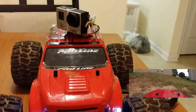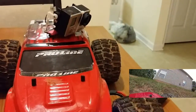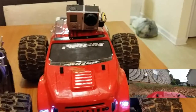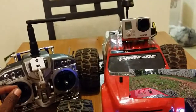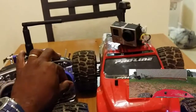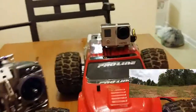The coolest thing I came up with is the pan and tilt — you can probably see those little servos back there giving it away. I can actually tilt wherever I'm looking, check the tire, see what's stuck, climb out of a hole and see what's best. I can look directly where I want, and look directly up. I'm working the tilt with the throttle stick, pan is on aileron, and throttle stick controls the tilt. I'll show you how I made this.